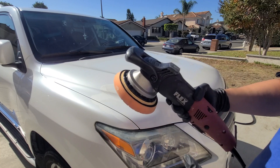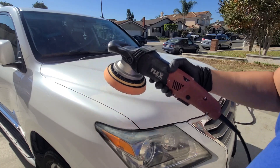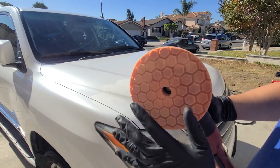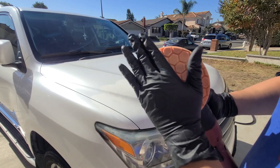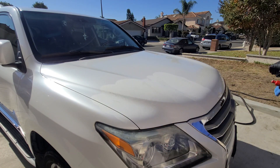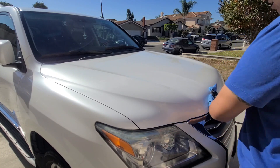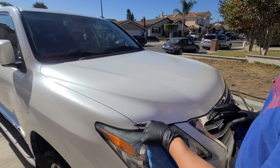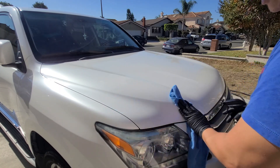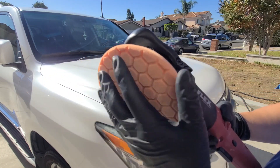You can see I did it in two different directions — I went up and down zigzagging, and then I went left to right. That way it covers the area. They call this dual action or random orbital because it replicates your hand — your hand goes into this wax on, wax off motion and that's what the buffer does. Now I'm going to clean it off, hopefully it makes a difference. Generally these edges you want to tape off if you don't want to contaminate dark edges with rubber. If you have rubber trim you want to definitely cover it because the polish will get stuck in the rubber and dry out.